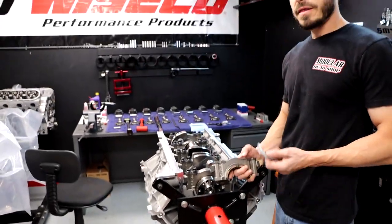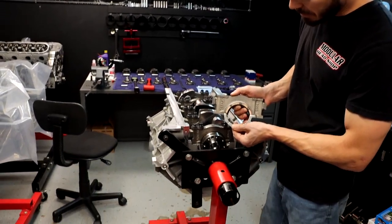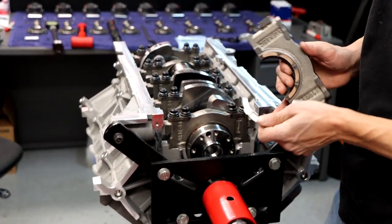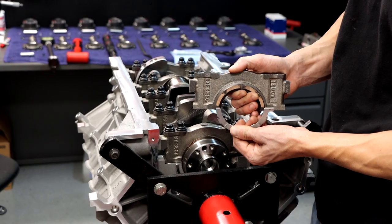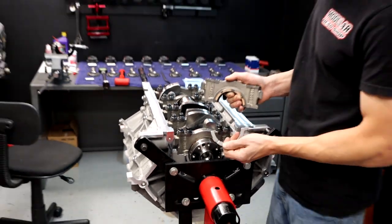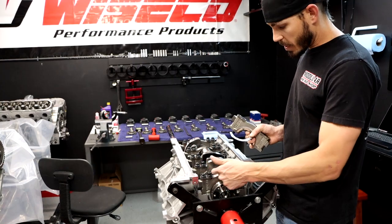The last thing you're going to do once you install the bearings is set the thrust. Setting the thrust means getting them lined up. When you put everything together, it's kind of luck of the draw whether these are going to sit in line — there's some wiggle room between the studs and the actual bore. If we're too far forward, we're only going to be wearing on the washer. If we're too far back, we're only going to be wearing on the cap. So what we're going to do is use the thrust flange on the crankshaft to pull them together and line them up as we're torquing.